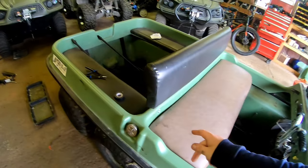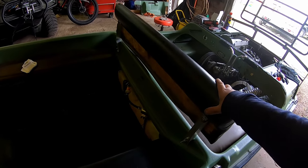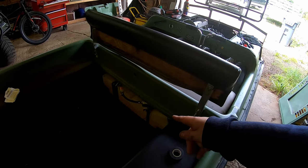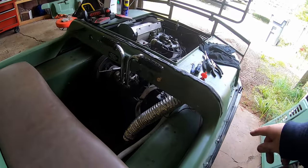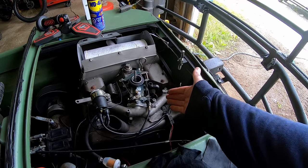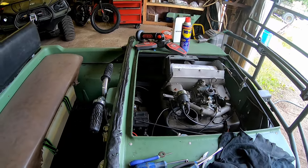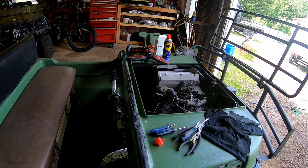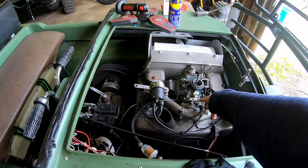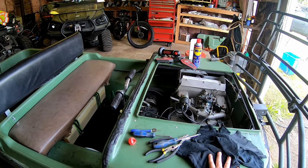One thing you've got to keep in mind with these little electric fuel pumps is you don't really want to go past 7 PSI. If you can stay at 1 or 2 PSI, low pressure, that's what you want. Because if you think about it, you're hauling fuel from here, in through the filters, up through the pump. Basically the pump is hauling it, and you're plumbing it right into the carb. If you've got too much pressure, it's going to flood the bowl. That little seal on the needle most likely is not going to be able to prevent the fuel from getting past it, because of the pressure. So the fuel ends up getting past your little needle, in through your air intake, down into the cylinders, and can cause a rich environment and flood your engine.